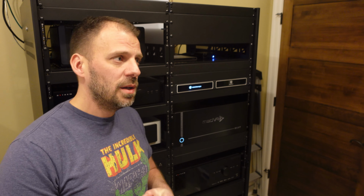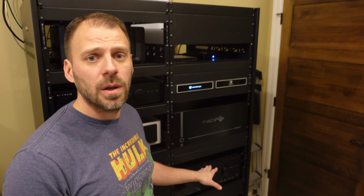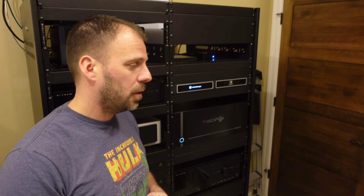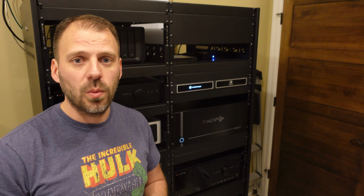Now there are some more nuances there because you're going to have to deal potentially with different HDMI identifiers, EDIDs, and so on. And so in some respects, maybe HDMI could be more reliable if you take both outputs from the madVR instead of one from the madVR and one from the AVM90. But ultimately, I think it's probably like six of one, half a dozen of another. I don't have my system set up that way right now, but I do intend to do that. I very much want to do that for a variety of other testing reasons as well. And I have another long HDMI fiber optic cable sitting right over here. Maybe one of these coming weekends, I'll finally pull that cable and I'll have two runs and I can experiment some more with this and report back on how well it works, one way or the other.